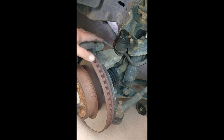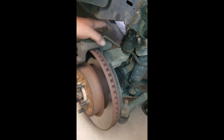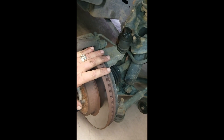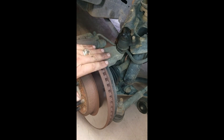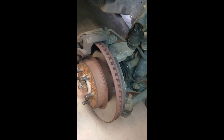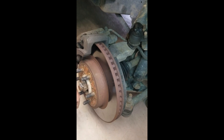Starting off, you're going to have to take your brakes off the car. There are two large bolts on the back that need to be popped off in order to get your brakes off. You'll also have to take off the rotor and get it out of the way. This can be a bit of a pain, but it's not too terrible. They tend to seize a little bit; I just did the rear brakes on this today and the drums — or the discs, the rotors — can be a pain to get off, as they get rusted on.